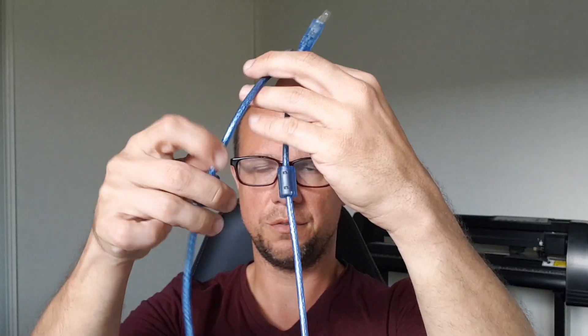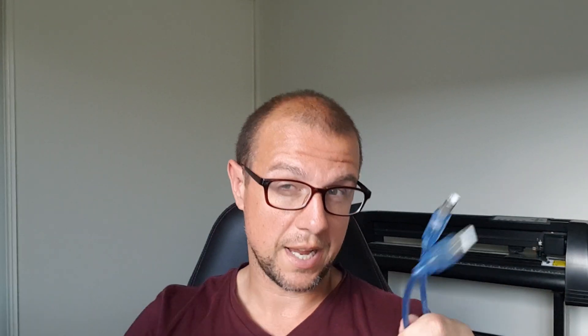This is the cord that it came with — it goes into the machine and then you've got a straight USB. Make sure you're using the correct cord, because you get a lot of cords with that sort of plug and I'm not quite sure whether they'll always work. It's also possible that your PC or laptop has a faulty USB port — mine does as well. One of my front ports works fine but the other doesn't, so make sure you can hear that USB sound come on when you've plugged in your cutter.